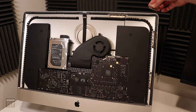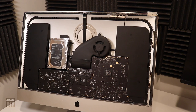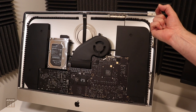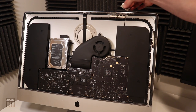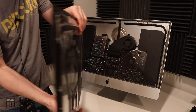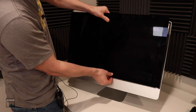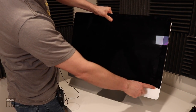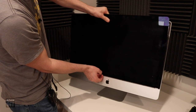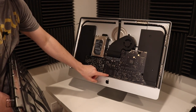You're going to be able to feel the foam that you're cutting through, so you'll know. Do a little bit and then leave a razor blade in. Then get another razor blade — not this style — and go, and you can leave it in. It's going to help keep the glass separated, which makes it a little easier to cut. Here is the screen; again, you can't separate these two. Be super careful with it when you take it off. It's going to sit in here like this. You don't cut the bottom tape — you cut the top and the sides, and then you can just pull it down carefully and it will rip itself apart down at the bottom.